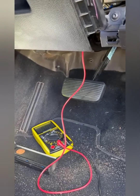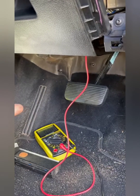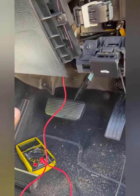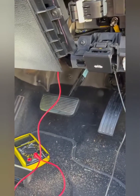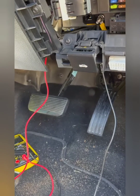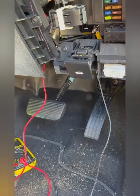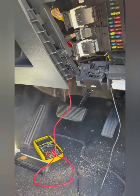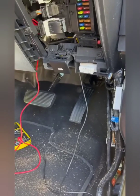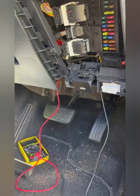Just make sure you know which version of the Ford Ranger or Everest you have and use that method appropriately. The reason being is when you've got automatic emergency braking, it works differently on the modules — in an emergency when it automatically brakes, it may not apply the trailer brakes. So to summarise: if you don't have AEB, pick it up off the brake light switch. If you do have AEB, pick it up off the trailer plug. Hope that makes sense. Hope this helps everyone and gives you the confidence to attack it yourself and save some money. Please like and subscribe if you want to see more videos, and leave a comment if there's anything else you want me to show you.